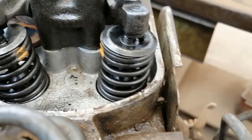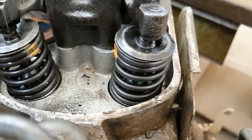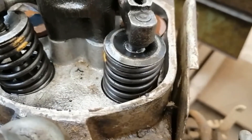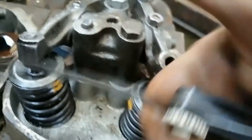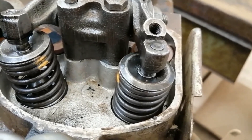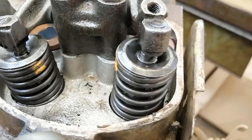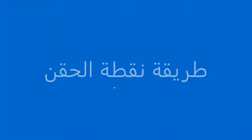Turn the engine to make the valve open. Look — this exhaust valve is going down, it is open. The intake is closed, so we adjust it. However, I do not prefer the valve-by-valve method because the cam itself has a straight portion in its profile. Due to this flat part of the cam geometry, I do not prefer this method.